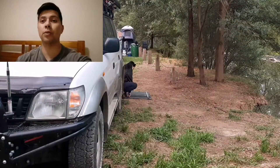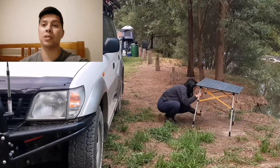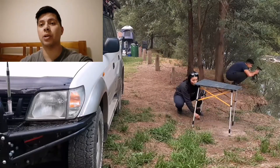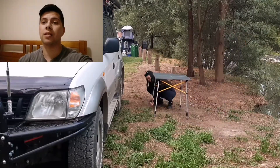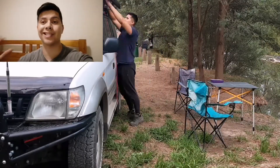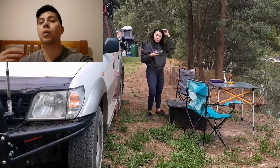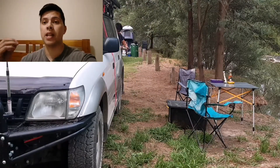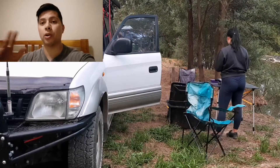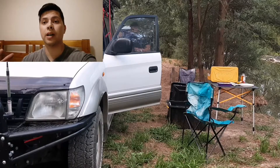Just to reiterate all the tests: I tested the auxiliary battery to see if it was totally discharged, because it is known that some isolators cannot charge a really dead battery as they can't sense any voltage there. I also tested all the cords and the conductivity of the cords and the fuses, and they were all good.